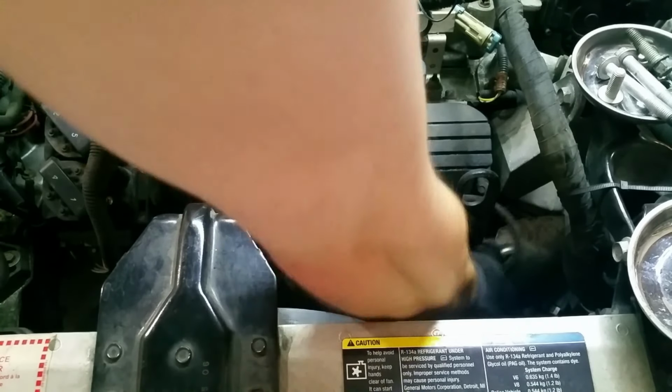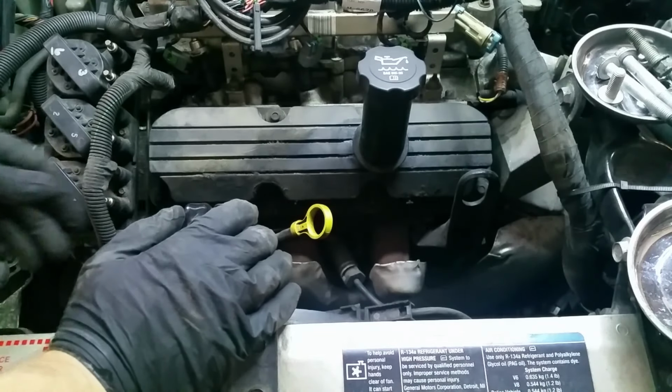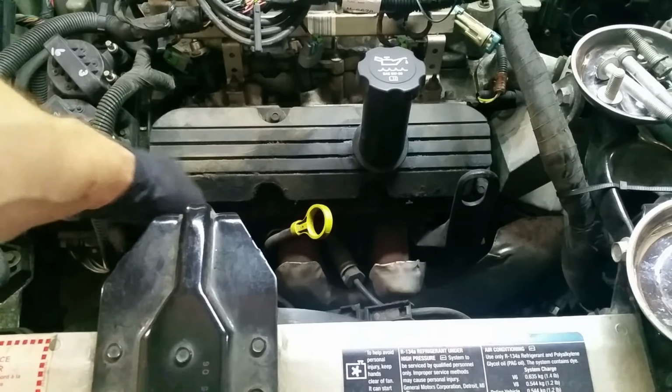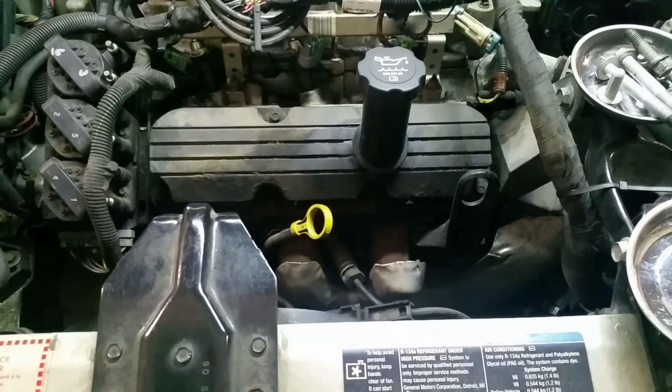I'm going to go ahead and take off the number 5 spark plug if I can. There we go. Just so I can really get this thing out of the way. Set it down in the front between the exhaust manifold and the fans. There. Now we have full access to 1, 2, 3, 4, 5, 6 bolts. It'll come straight off, and then we can inspect what's under there and replace the valve cover gasket, as well as anything else we need to do.